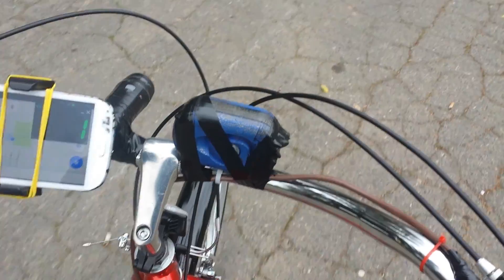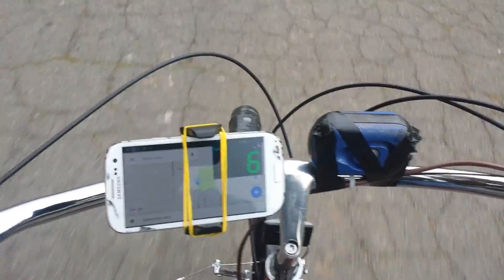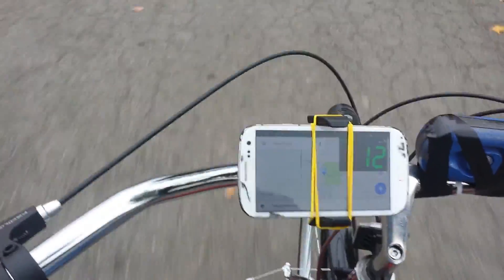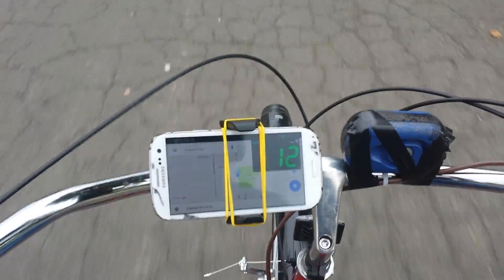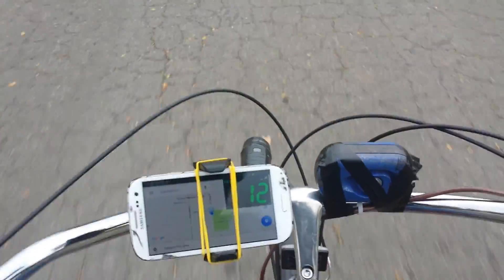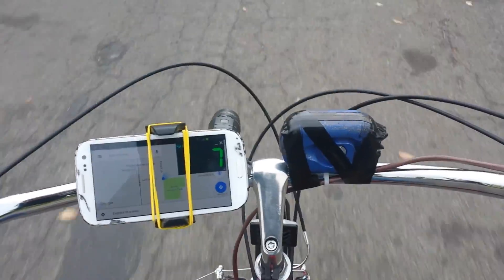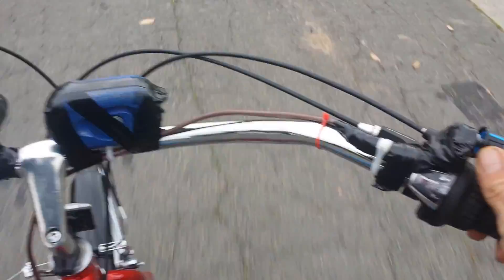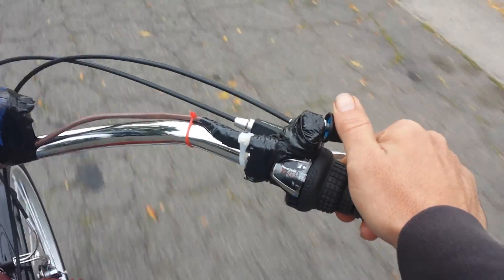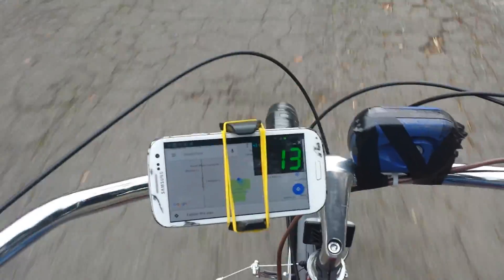All right, we are out of the park. I got a good run-up here, so let's go through the gears — first, second, third, fourth, fifth, and sixth. Let six pick up speed here. You can see in sixth gear we go up to about 14 mph. You can go from almost a dead stop in sixth — it's just got so much torque. I just roll the power back in. When I take off I'm not going full speed; I don't want to add too much stress to the chain. I just kind of roll it in, and as I do it picks up speed. That way it lays down the torque somewhat nicer than giving it all at once.